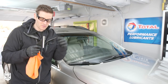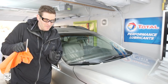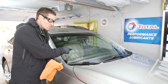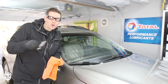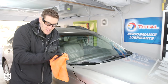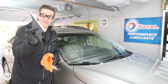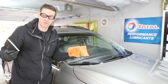I think it's the pressure and the rubber. With a microfiber towel there are always little gaps, which is what we want for picking up wax or whatever. But on glass you want that rubber making contact as hard as you can and squeezing — there's just no room for gaps. The fingerprints and oils get pushed out under the pressure of the squeegee. Maybe I'm overthinking it, but the moral of the story is this thing kicks butt, it's $2, and you can do glass without freaking out every time.